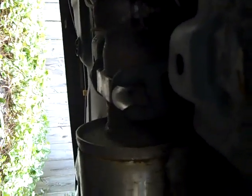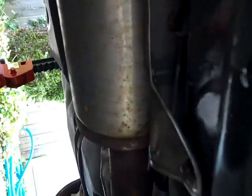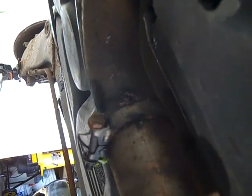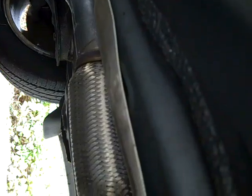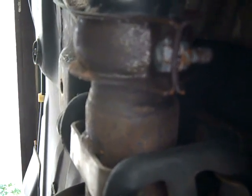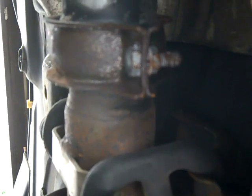The first step is getting the exhaust out of the way. Mine's going to be a little more difficult because I've got a performance exhaust system with big pipes that are sleeved together — they won't come apart as easily as the original Saab. Here's an example of the original Saab clamps — see the flex pipe has just been recently changed. These are really nice. It's a ball end and the clamp; when you tighten it up, it just squeezes together. You've never got an issue with sleeved pipes. These will come right apart, so if you want to change a flex pipe, it's easy to just pop it in.